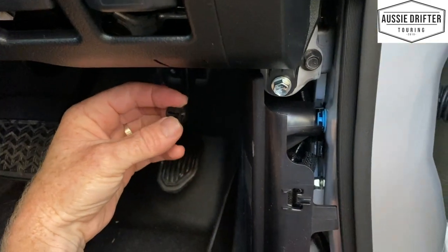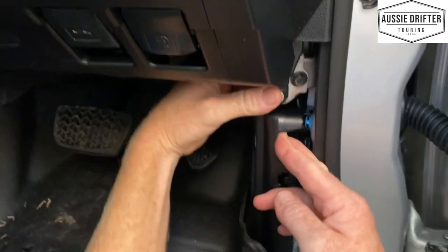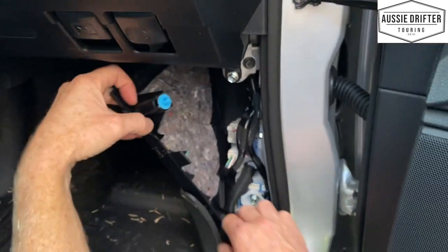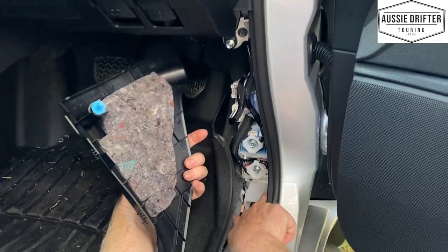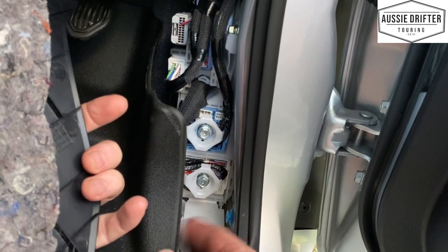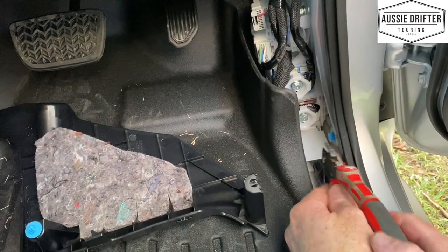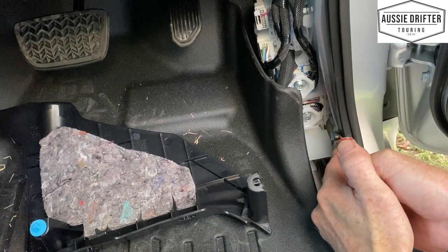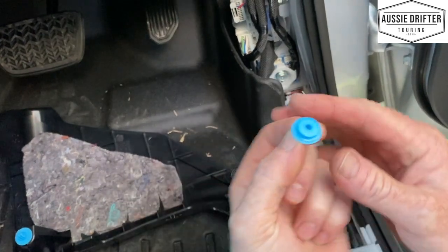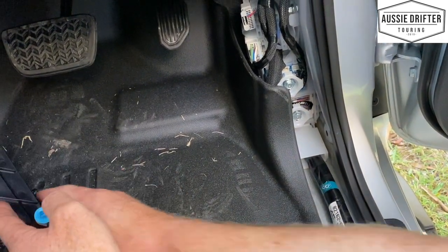That can just come off with your finger — no tool needed. Once we've got that off it's just a matter of pushing this away from the vehicle. Sometimes one of these clips will stay in the body. What we do is get a pair of side cutters to go in behind that section of the blue clip, pop it out of the body, and put it back into the panel. Just going in between those two layers, levering it away from the body — once we've got it out we reinsert it into the plastic housing, good and ready for reinstall. You can see that's given us good access.